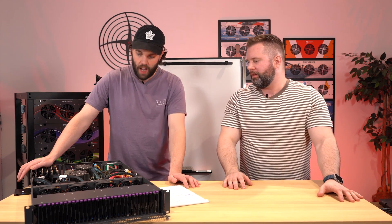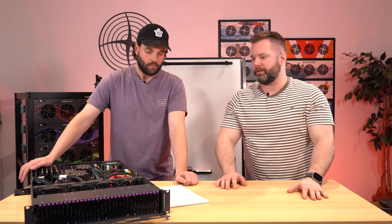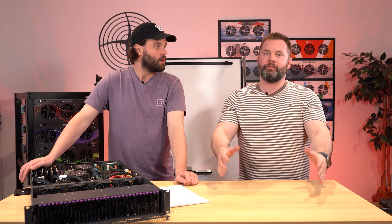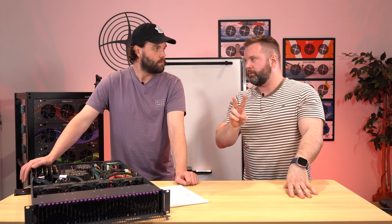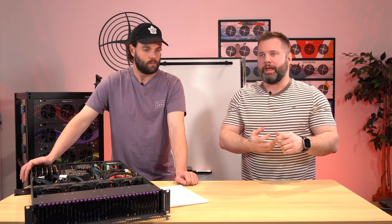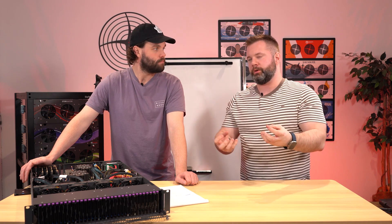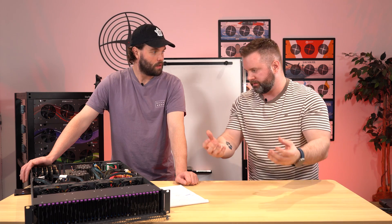The electronics are updated as well — that's another big thing. Obviously with NVMe comes a ton of extra performance. We wanted to update the electronics of our NVMe system, so we are running two different SKUs. One is the Milan AMD EPYC CPU, 64 core. And to get an Intel equivalent, we need to do a dual-proc system — two 32-core CPUs giving us the same 64 cores.